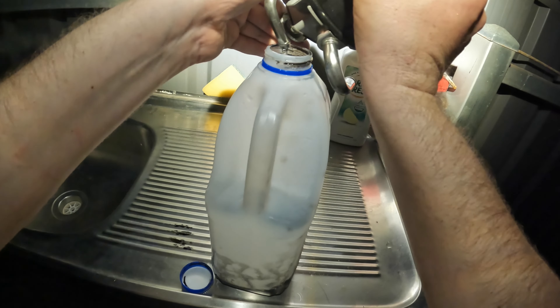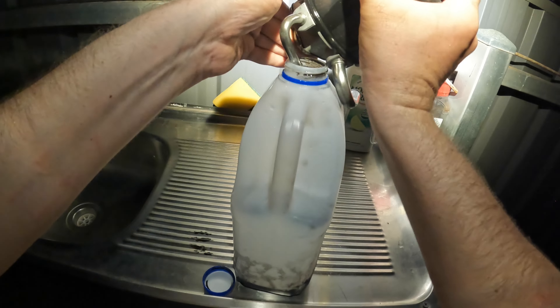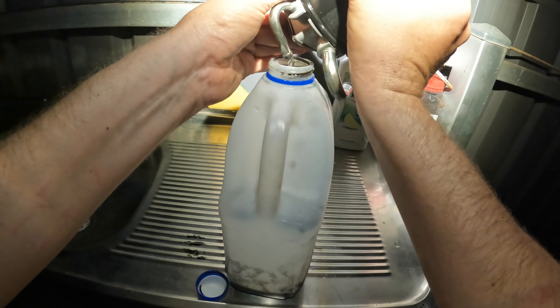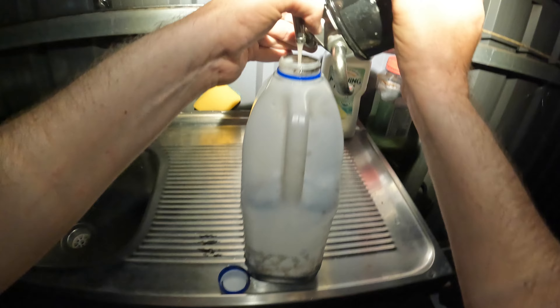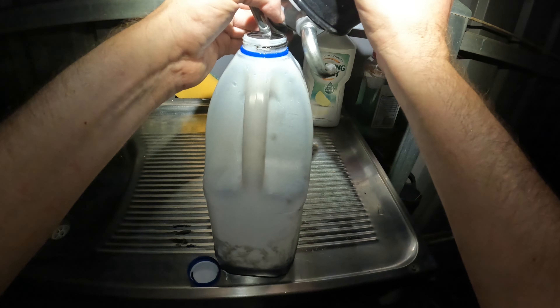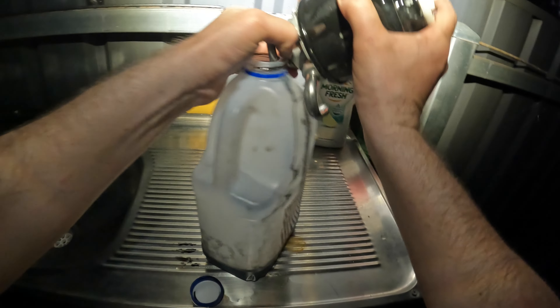So there's just 12 mil bolts, come up easy enough. You'll just need a flathead to get these two hoses off. Once you've got these two hoses off you might lose a little bit of diesel, so put a rag down there. You'll have this clip here that holds on the little valve, and then you should be able to just lift her out. That's it there, and you can put that assembly somewhere where you can work on it.